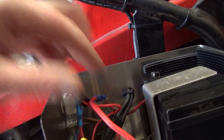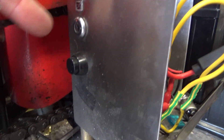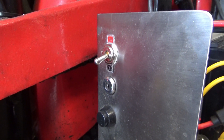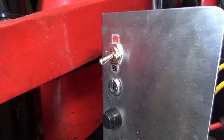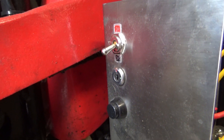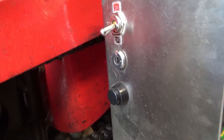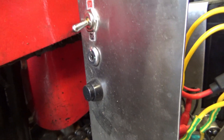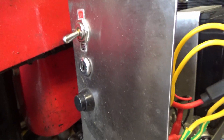I've got various switches and things. One thing I have also put on is a key switch there — that puts the CDI to earth, so if I turn that on you cannot start the bike on the electronic system. It's basically to stop somebody wandering up, kicking the bike, and riding off, because they won't be able to start it. It ain't going to stop them picking it up and stealing it, but it's something — it helps.